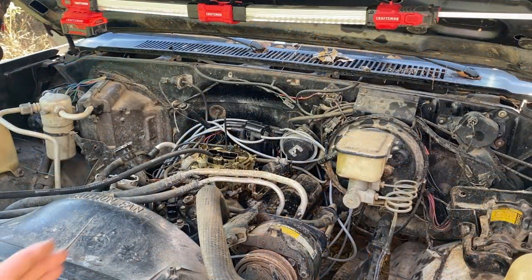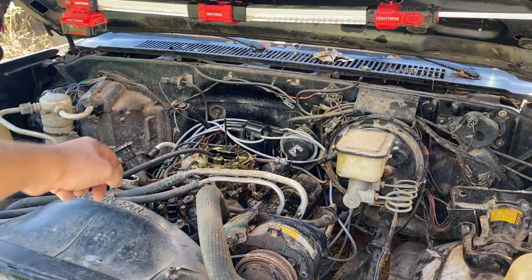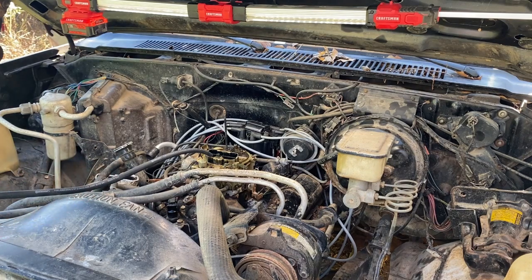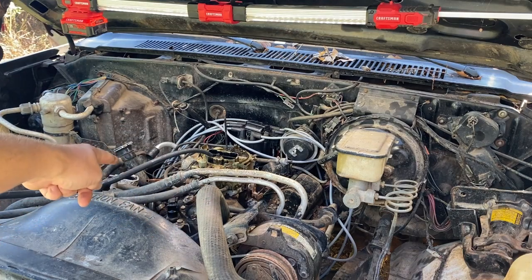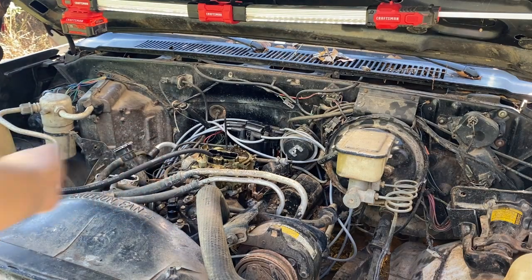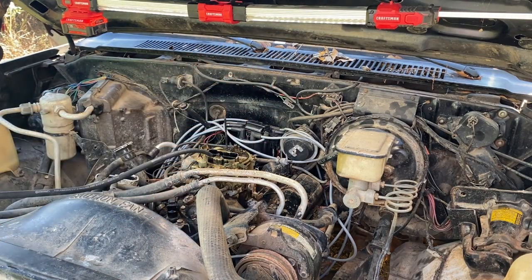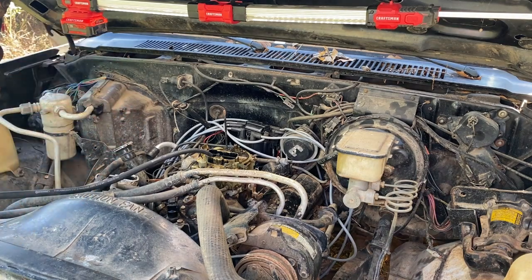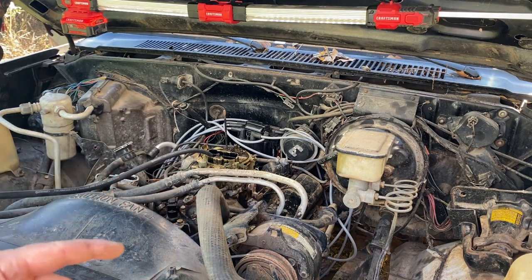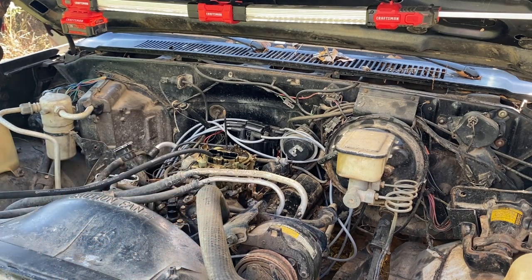So there's definitely an issue down here, because when I had the pump running, I could hear it running. When I pulled the hose off of that piece of pipe, gas sprayed everywhere. So it's pressurizing there, but it's not getting in the carb. So we obviously have a problem in there. Some junk or some trash got in there. So what I think I'm gonna do now is see if it'll start, and then see if I can bottle feed it with the pump.